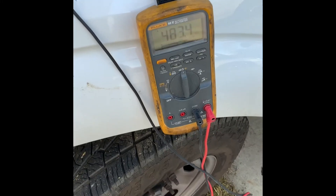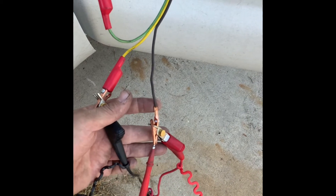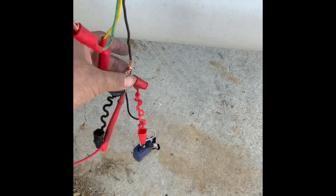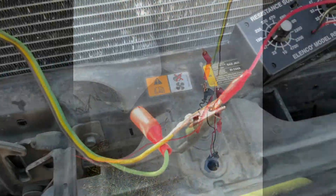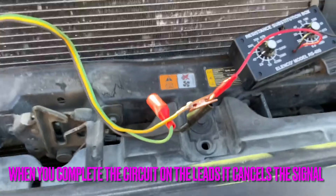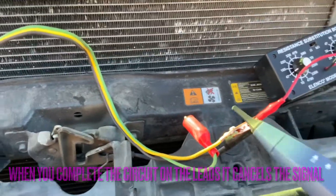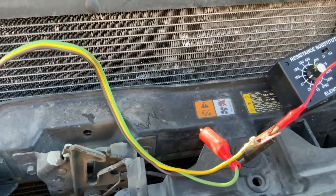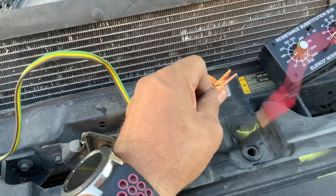I'm going to take off the meter so I can demonstrate how this works in automotive. Right here, this is the way you connect it — say this is the wire we're trying to investigate. You can use the black lead or put it to ground, but what happens is the signal goes through both wires. I'll show you in a minute what happens. We have the black and the red connected, and you kind of cancel out the signal — you won't get any beeping sound. So I highly recommend you only use the red, or make sure there's no short.